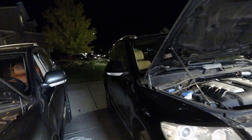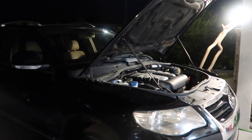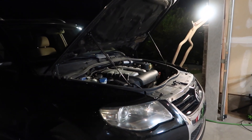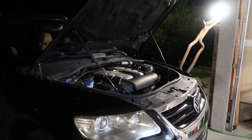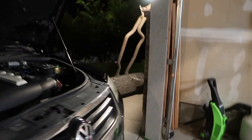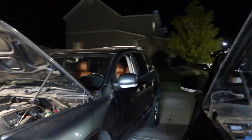We're currently having some vibration. Now, it's interesting because it's not quite the same as before. When the driveshaft goes bad, oftentimes people complain about a knocking — basically the driveshaft is going around and knocking around the underneath of the car, the exhaust hanger, that kind of stuff. I have definitely noticed some vibration going on. It doesn't feel like it did before, but I can feel it — kind of on the low end, and then right about at 75 miles an hour on the freeway. Between there it's not too bad.